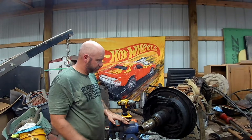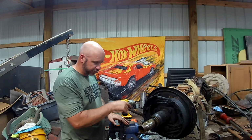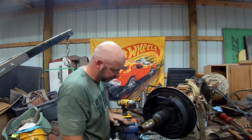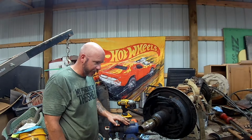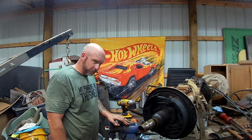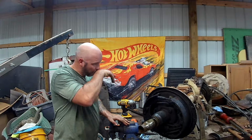So we'll probably do pinion seal, crush sleeve, brake shoes, brake hardware. The cylinders might be okay, but I wouldn't count on it. We'll probably do cylinders. On Rock Auto, they're liable to be between $6 and $10. So, time to get on the interwebs and do some shopping, get all that ordered up.